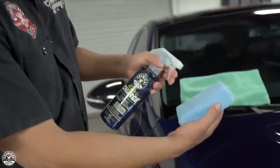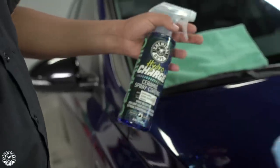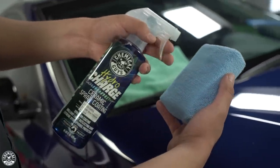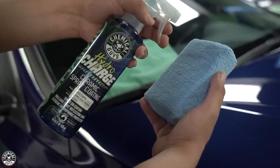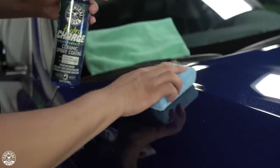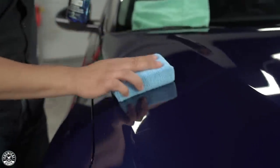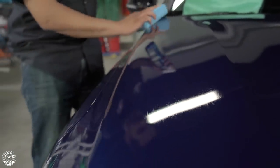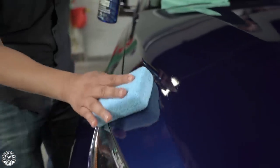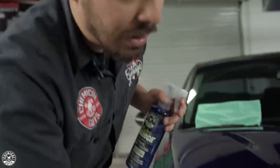To use this product, all you've got to do is spray it directly onto a microfiber applicator. I recommend spraying onto the applicator and not onto the paint because you don't want overspray all over the place. HydroCharge is intended for painted surfaces only. All you want to do is spray two lines of product and then spread that onto the surface of the vehicle. Whenever you're working with a ceramic product, you want to make sure you're using straight motions — don't apply with a machine, don't do it in a circular motion. Apply an even coat so you get the most uniform coat possible. Also, work in small sections. Don't commit to doing a whole entire hood — do about half or a quarter of the hood so that you are in control of where and how much you're applying.